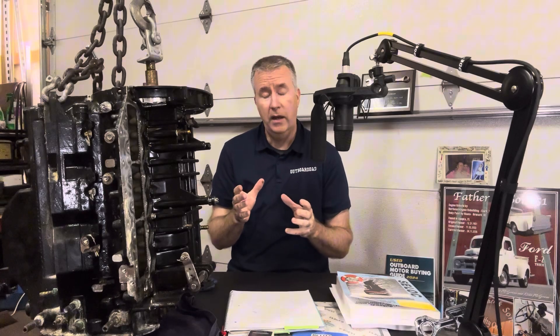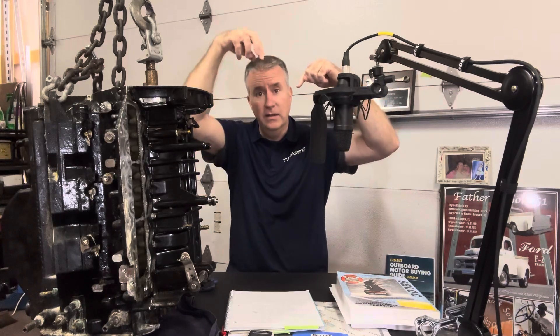Mercury advanced a little bit more and put an oil tank on the engine. They have an oil tank in the boat that pumps to an oil tank in the engine that has a sensor in it, so that if it gets low it sets off your alarm. It's a little bit safer, and it gravity-fed down to a mechanical oil pump that ran off the crankshaft. Unfortunately, they did use a plastic or fiber gear and that did fail from time to time. So a lot of guys will blank off that oil pump shaft and run their own mix, using a blank-off plate that ProMarine makes for it, for more longevity out of their motor.